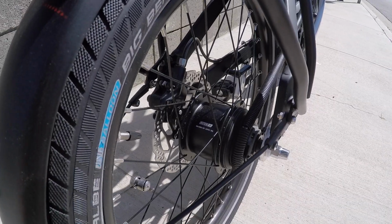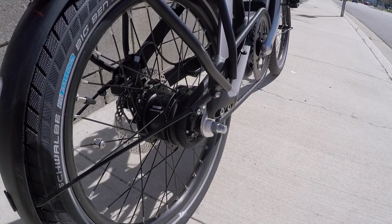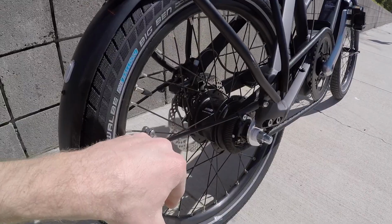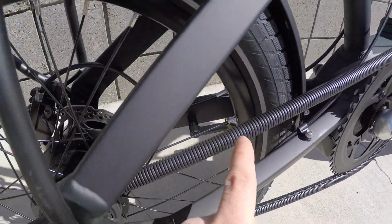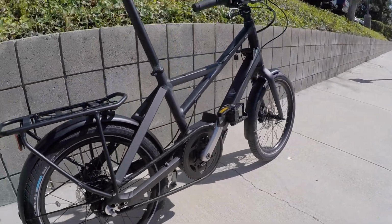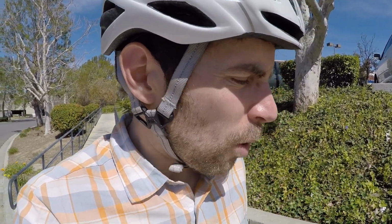And then even the Inter 8 internally geared hub in the back is black as well, and the chain, and it's really good. So again, with a motor that's measuring really dynamically how you're riding, that rear wheel speed with the magnet there and the sensor on that side, pedal cadence and pedal torque, it's dynamic. It feels really good. And Yamaha has this whole zero cadence start thing that they like to advertise. The idea is that as soon as you start to press, you have power right away. So it feels kind of as responsive as a throttle or something. You get the support of that motor up to 70 Newton meters of torque.